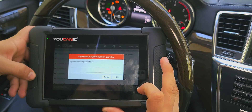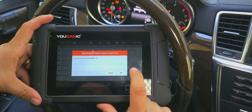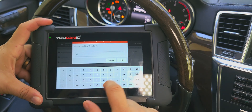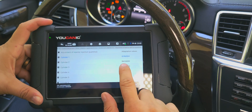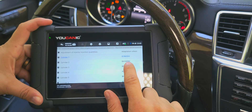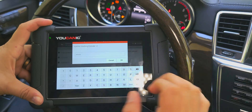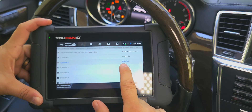Select the injector you want — let's say this one — press OK. Make sure it says Cylinder Two and that you're looking at the right one. I will enter AII65, which is the code for the new injector. I'm going to hit Cylinder Two. The code currently stored is BA166SH. We're going to change it to the new injector code. Hit OK, and enter AII65.